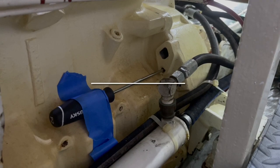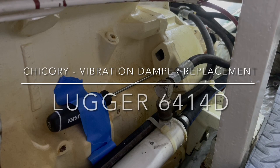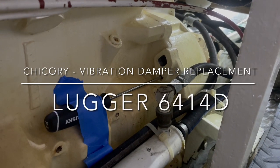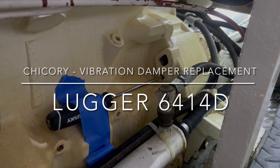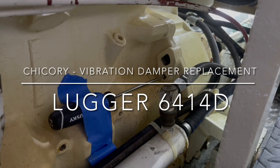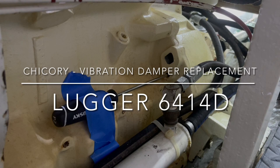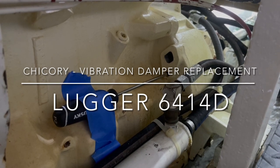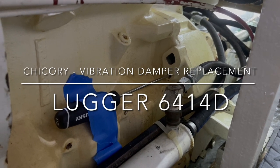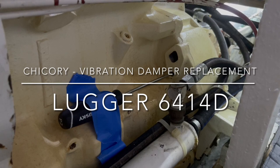The very first thing you need to do is lock the engine. My bell housing is probably a little bit different than yours, but you can see there's a top dead center finder in the back of the engine. I simply rotated the engine while Tracy put pressure on a screwdriver until she found the hole in the flywheel to lock it, and then we just taped it in position so I could crank on the bolts on the front of the engine without rotating it.